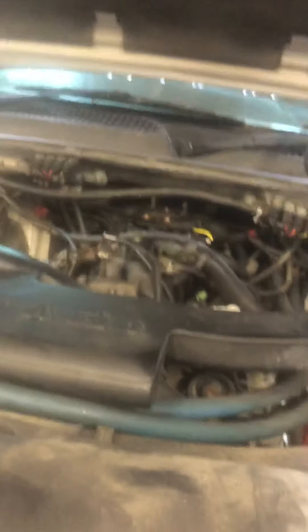It will work, and if you did have a knock issue, it would hear that knock on the side of the head. This vehicle runs on LPG propane, so knock is not going to be a problem — it's just a case of doing this to get rid of the engine light relatively easily. If I sell the car I'll point it out to the new owner. Anyway, that's something you could try if you can't be bothered with the hassle of removing the whole intake manifold.